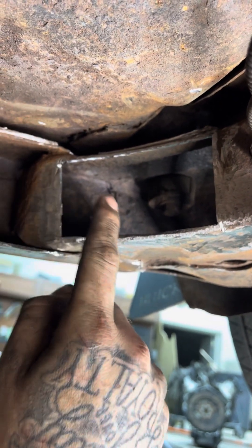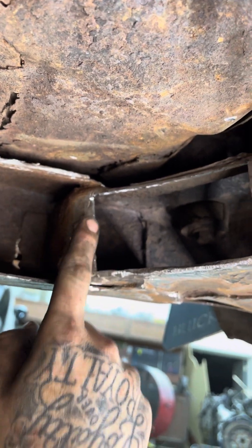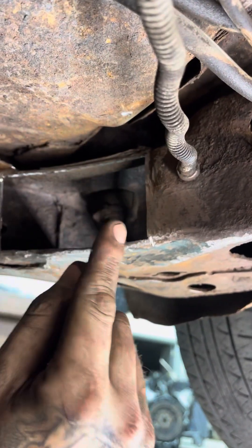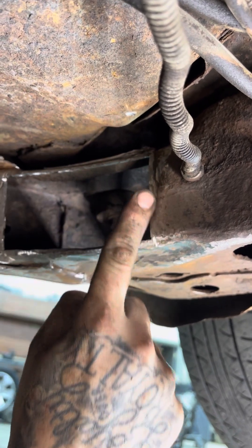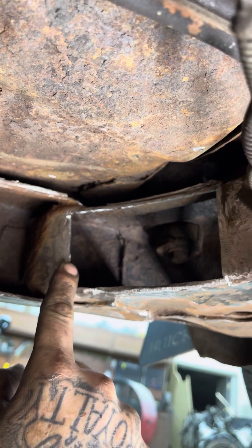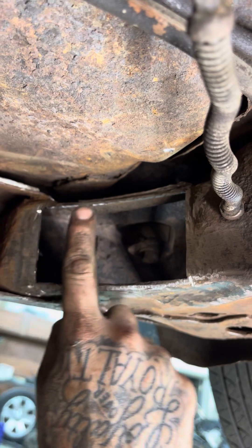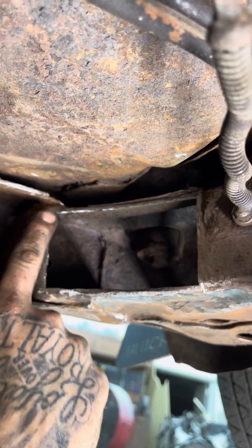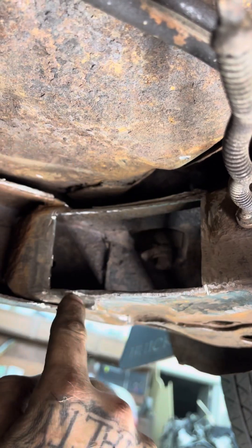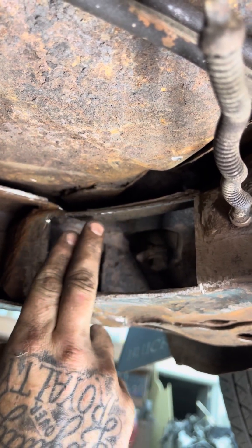That structure as well - I couldn't replace this part right here without replacing this, so it's going to be like a two or three step process. First I'll cut a patch in here, bevel my frame down a little bit - I started a little bit but it's kind of hard to get in there. I got it cleaned up. Now I'll make a piece in here; it's got a slight curve to it, so I'll take a piece of 3/16ths, first take my paper like I always do and get my size cut out, then use that as my template.